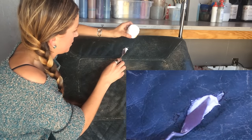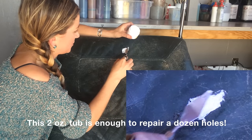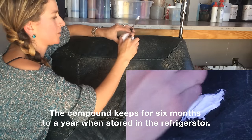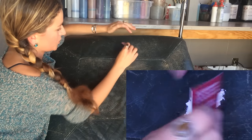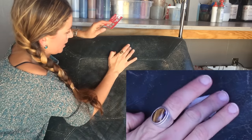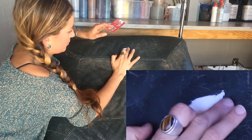Throw a blob in there. Really work it into these edges, the perimeter of the tear, in case you missed any spots with your glue. The compound will also sort of act as an adhesive. Close this up immediately — it does tend to air cure very quickly and you don't want it to spoil. I like to work with a glossy business card for spreading. Just do one swipe in the direction of the tear. You're not going to get it perfect the first time — I've got some little craters of the moon up there, that's okay. I'm going to feather out these edges just along the perimeter. You could also sand them out later, but this compound feathers really beautifully.